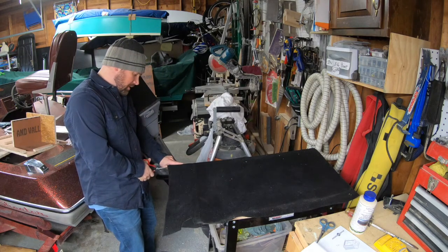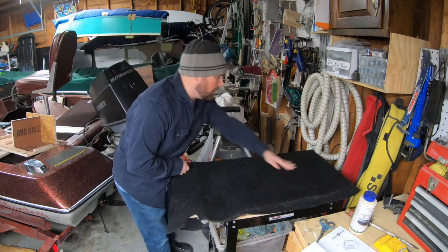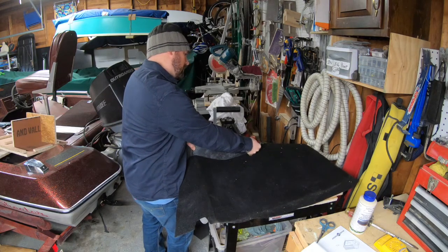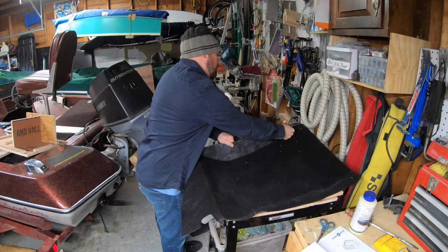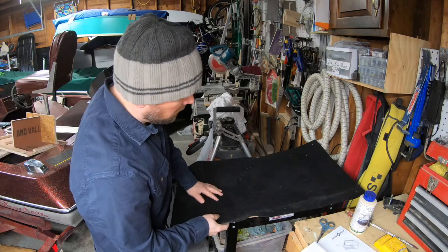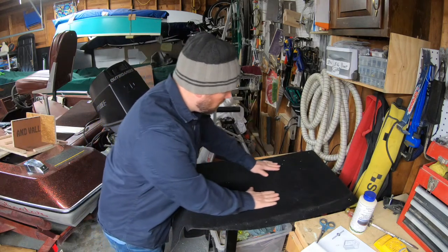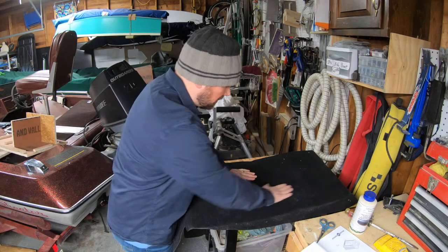We've got a cap for Luke's pickup truck that is carpeted on the underside, and it just looks really nice. So I'm going to try to take advantage of some of this free material that we have and glue it down. So I think the best way to do this is to put some glue on and smooth it out, and then get a razor blade and trim the edges, and that should make it pretty easy. So that's what I'm going to do. And then we can vacuum it, and then we'll flip the panel over and do the other side. And the other side will be folded and bent on it. So hopefully it won't be too thick, but I think it'll come out nice if we do it this way.